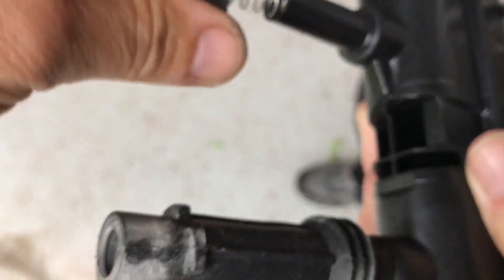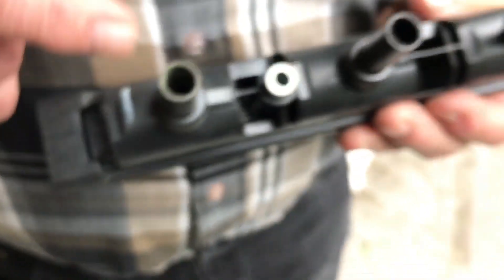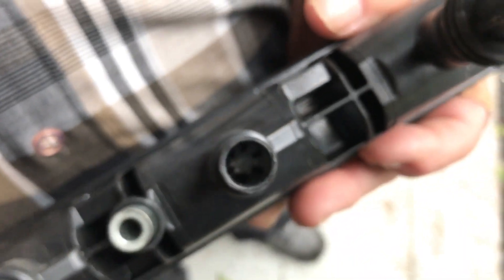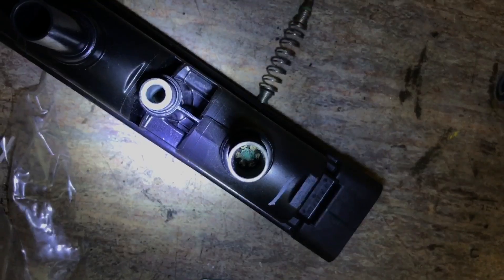Let's take its neighbor off and have a peek — see if it's joined up. Now that it's separate, we've got a spring. So we're getting moisture down in there causing a bad connection. Look at the greenness — dirty all around. Now look down inside that one — clean as a whistle, all nice and shiny. Let's check them all.